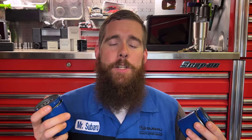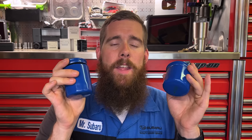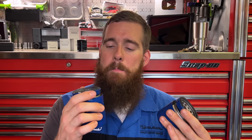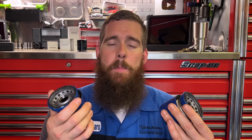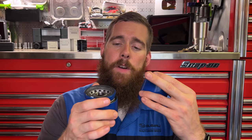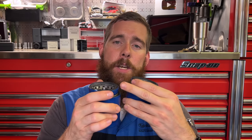Not so long ago, due to shortages and the way the world has been for the last three years or so, Subaru could not source those oil filters. For the last six to eight months, if I recall correctly, we've had these generic blue, non-labeled, non-branded oil filters coming into Subaru dealerships. The construction was mildly better when tearing these apart compared to the previous blue filters, but these were still kind of junky, and there were lots of issues with leakage from the seal.